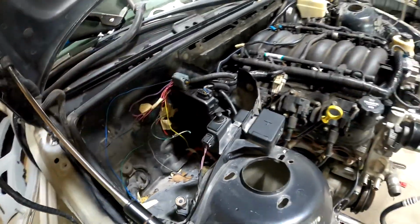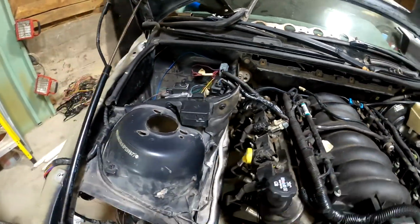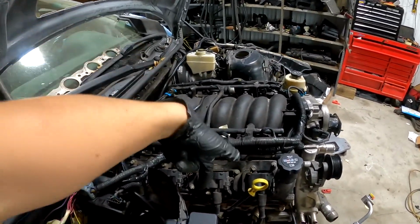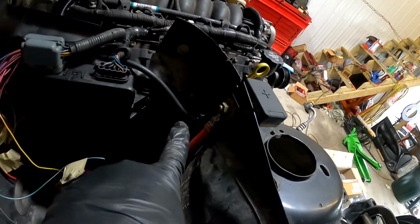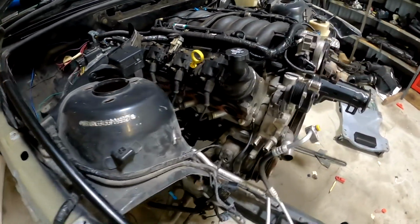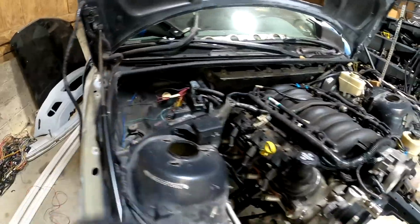Also, this is an option. I don't know. Either I'm gonna run it all the way across the engine bay and inside, or I'm just gonna run it inside and under the dash. We'll see. My power wire is right here. It's connected. It goes from alternator and from starter into this wire, and meets together in here. Right, bolted together, and this just slides on top. And my ground wire for the block is going from the original BMW one post into the block. I need to put some shrink tube on it. I need to make the fuse box. That would be probably next.